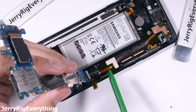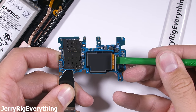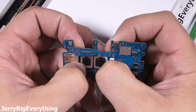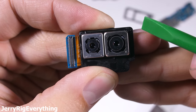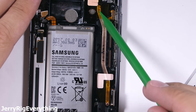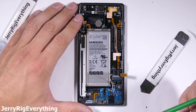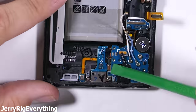After the motherboard's out, the cameras can come loose — they're both tied in as one unit. That's a bit different than the dual connection setup that the LG V30 had, but cameras are pretty cheap to replace, and having them connected as one unit isn't a super big deal when it comes to cost or repairability. Looking at the frame of the phone, we get the copper heat pipe snaking down the side — this wicks heat away from the processor and transfers it into the frame of the phone. I took a thermal imaging camera to the one inside my LG G6, and it actually functions surprisingly well, more than I thought it would.